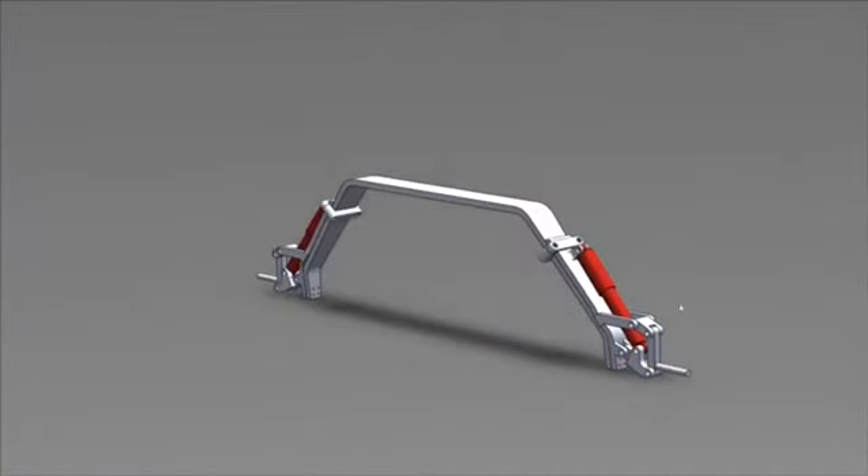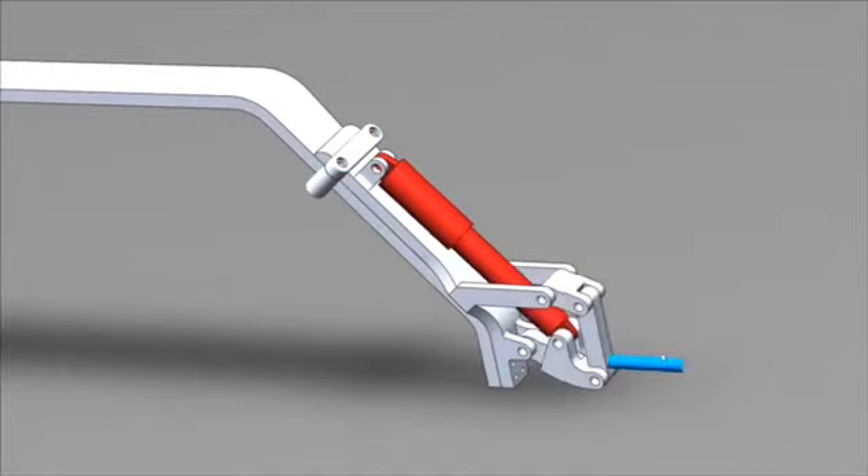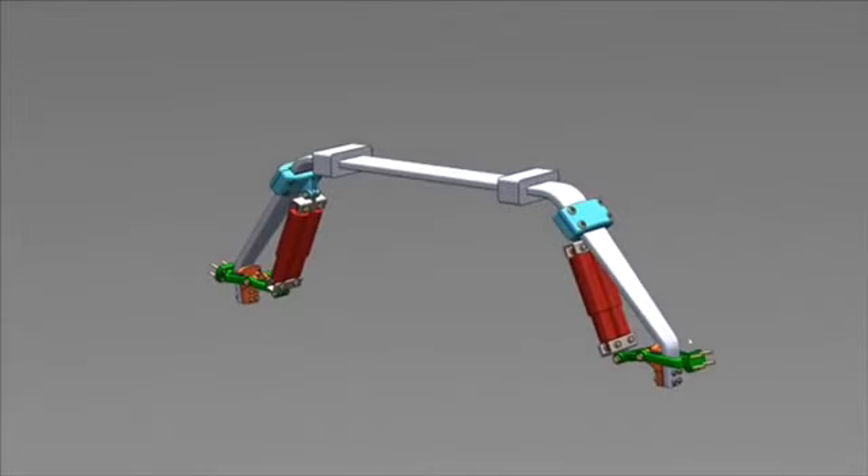One of my goals was to make this system as aerodynamic as possible, so I wouldn't lose much on cruise speed. Then we came up with a flush design, where the shock is basically parallel to the aluminum gear. We fitted the shock on the outside top of the gear, but then it just didn't feel right aesthetically. We decided to move the shock to the inside, bottom side of the gear, which gave us a lot more flexibility, especially in the shock size and the framing where the shocks are going to be secured to.